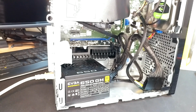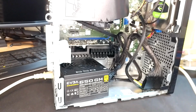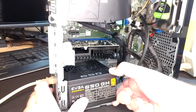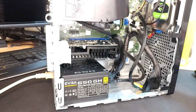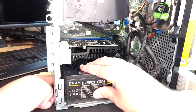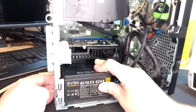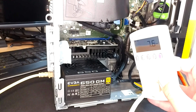It did just do its immediate boot up thing. And it did just immediately shut down, but the power supply is still drawing 8 watts. So I think this power supply, the fan is probably still spinning, or something's still going on in there. Fan's not spinning, but it is drawing phantom power. It's pulling 8 watts, the Dell power supplies pull 0. So if I hit the power, now it's down to nothing. So it appears this does not shut all the way off, which we knew that going in. At least I expected that going in. I just turned it back on, so it did its quick power up and down thing. And now it's just going to be a 7-watt energy vampire.